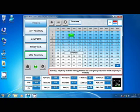So for example, I go back on petrol, and then I switch again on gas. So you see we are still a little bit rich, and if I go over RPM or change the load a little bit, as you see here, it turns red. It means that my reference is wrong.